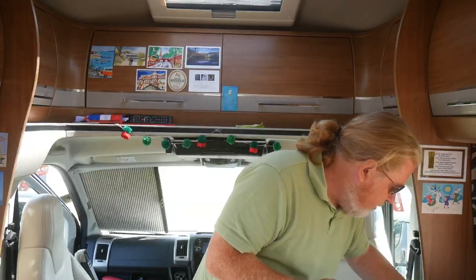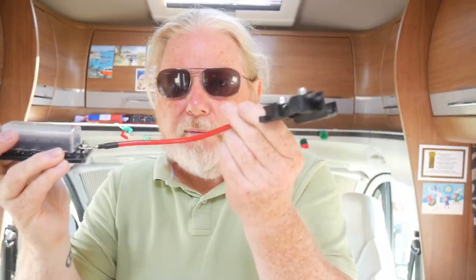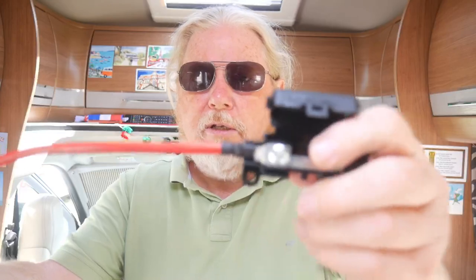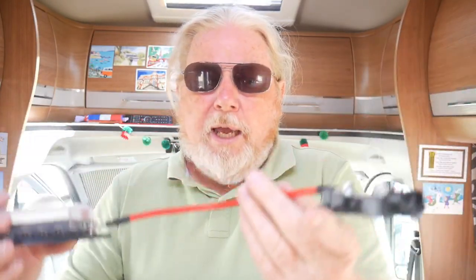I've already started to wire the fuse box up. Imagine this bit of wire going from the live to one of these fuses and then obviously a bit of wire going to the earth. This is live coming in — this is a 60 amp inline fuse that just closes over and seals. I've made that connection already, and a similar cable will run from the other end of that fuse out through the floor just under there and onto the positive side of the first battery.